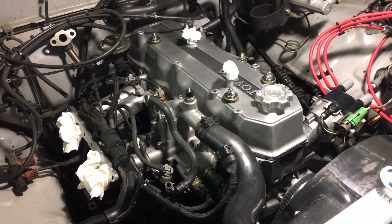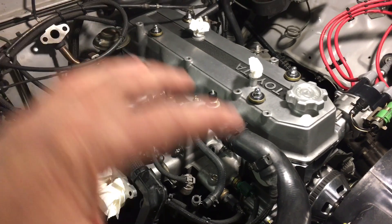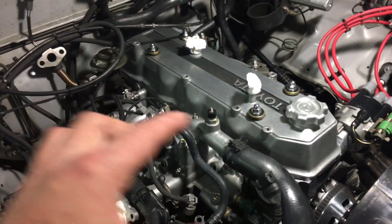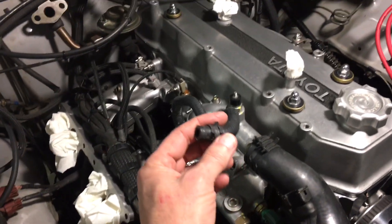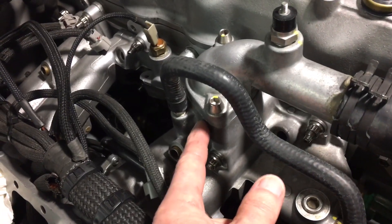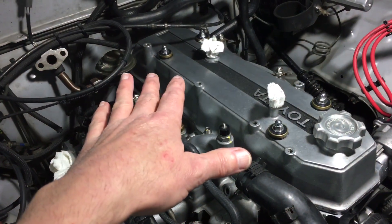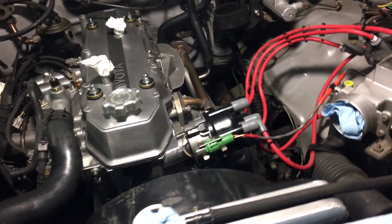When you're trying to purge the air out, no matter what you do, it seems like until the thermostat kicks open the motor runs a little off. I think that's because there's air locked up in the cylinder head. So this time I'm going to try leaving this little hose open - it's the supply line to the idle air control valve located underneath the thermostat - and do my funnel trick to bring the coolant level up and purge the air out of the cylinder head.